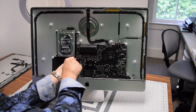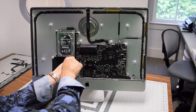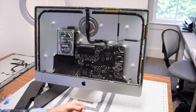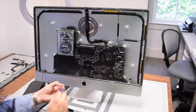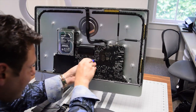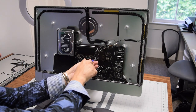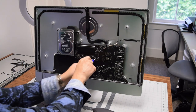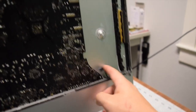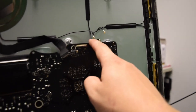Once that side screw is in, place the T20 post back in. With that secured, re-secure the remaining six T10 screws going around the contour of the logic board, and of course the seventh T10 screw mounting the logic board in that hidden center hole.